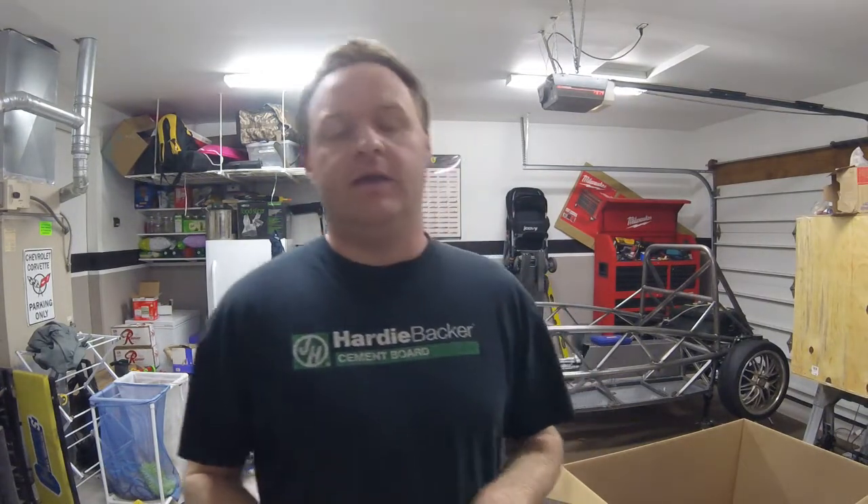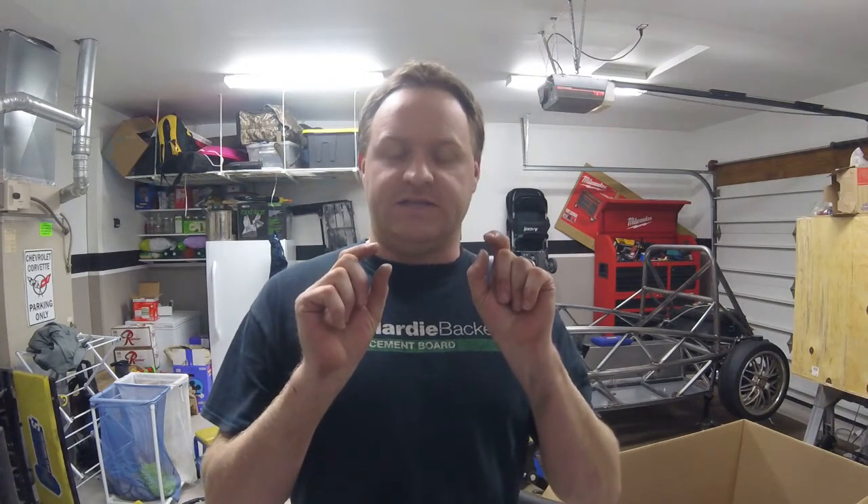On this episode of Building the Exocet, I'm going to show you guys how to hook up and run your fuel lines for the Exocet. Basically, I didn't buy the $300 kit from Flying Miata or Exomotive. I made my own stainless steel braided lines that run from the tank up to the firewall in the tunnel. Since I'm running an NA fuel system and I can't find a way of getting AN fittings up to the fuel rail because of how it tucks through the intake manifold, I ran fuel injection rubber hose from the tunnel up to the fuel rail. I already have everything installed — I'm just going to show you my routing, what I used, and give you an idea on some of the fittings.